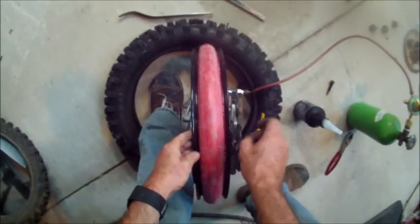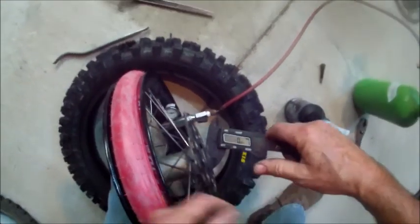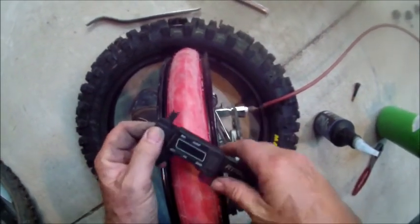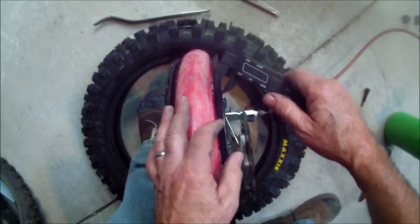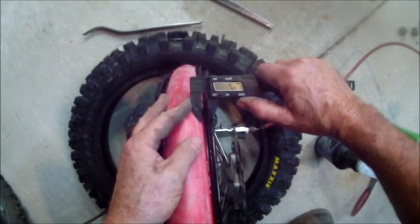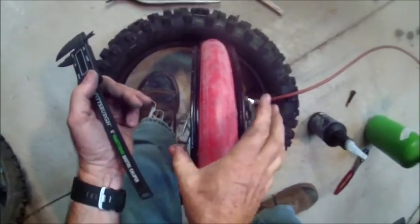You can tell this guy is swollen up now — it's inflated and it's reasonably well-centered in the rim. What we're looking at: imagine your tire goes down in here, and when this thing swells up, it's going to pinch your 125-pound bladder right up against the bead of the tire, which on the other side gets pressed into the rim. You've basically got a rim lock for the entire circumference. We're looking at about 7.69 millimeters that we need to fill, plus some tension. That's full — that's as big as that thing is going to expand.